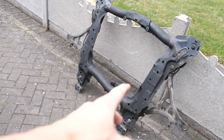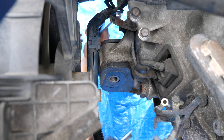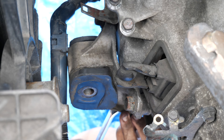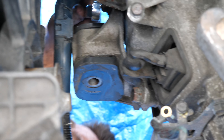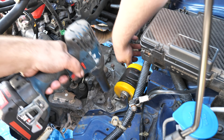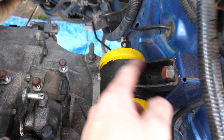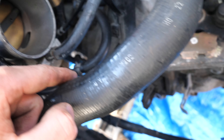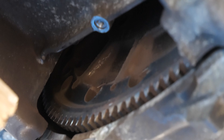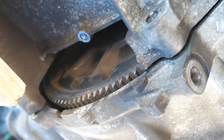That's been sorted — lovely, easy as that. Just lower it, undo all the bolts. We've also got a hard race engine mount to undo. There are three bolts holding the gearbox mount in place — one, two, three. We've also undone the starter motor. Apparently we've got an upgraded flywheel on this already, which is a nice surprise.